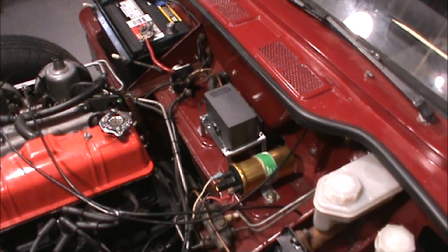Here's what the RTMR looks like with the cover on. You'll note there's a lanyard that bolts the cover on so you don't lose it. What's really nice about this RTMR is that it is IP65 rated — rated for dust and splash water, not full submergence, but it will handle the splash water that gets inside the engine compartment. With all the cavity plugs in place and properly installed, it should preclude any water intrusion into the wiring circuits.